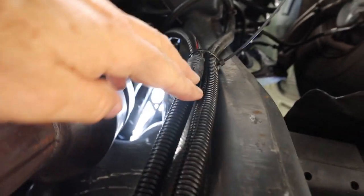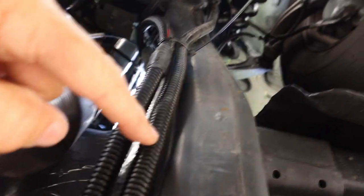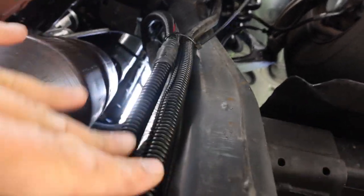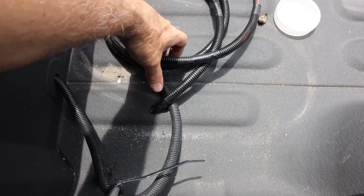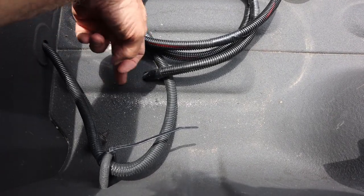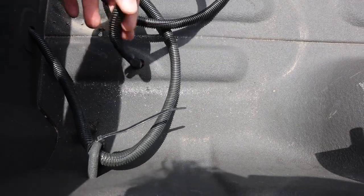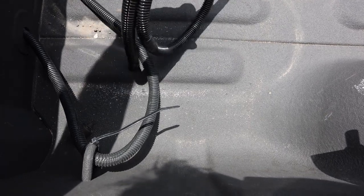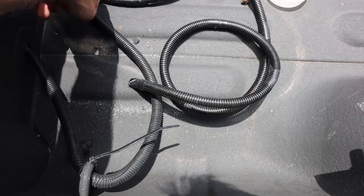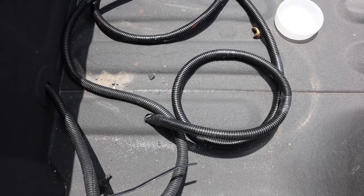Here is the wire harness I just ran, and here is the wire harness that provides the two trigger wires for the DC-DC converter — I wired this ages ago and I'm now routing the new wire bundle right next to it. I'll keep working my way down and zip tie this up. I have the hole drilled in the bed; I had to move the hole away from a beam to be able to drill up through the bed, but I've measured my bumpers on the camper and have plenty of room to clear them. This cabling goes directly to the DC-DC converter, and the other cable is for the trigger wire and low-current wire on the DC-DC converter. We are all wired now in the vehicle.